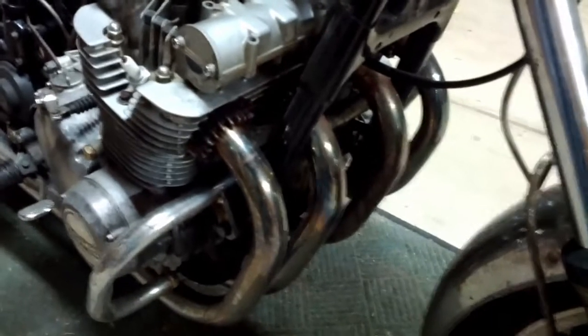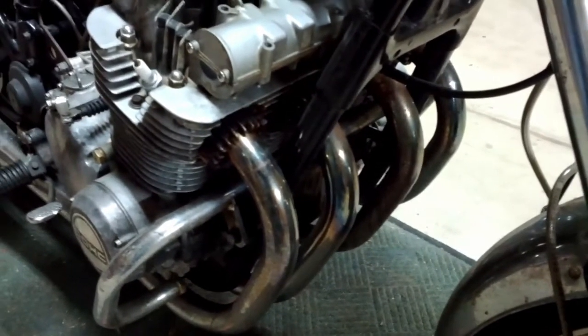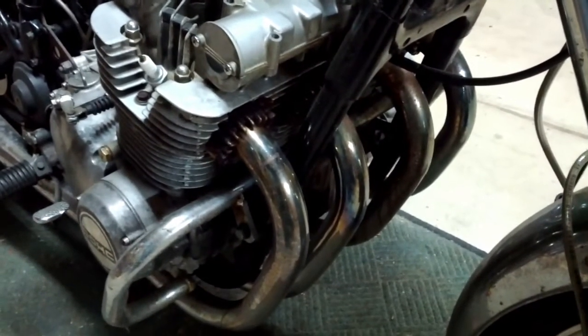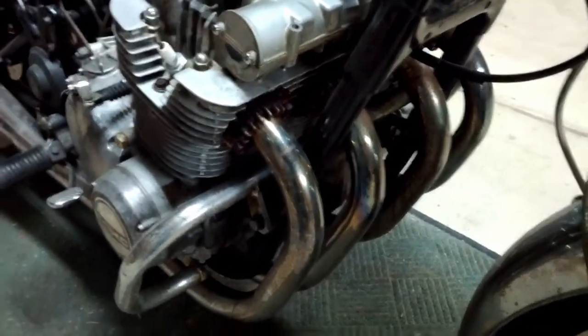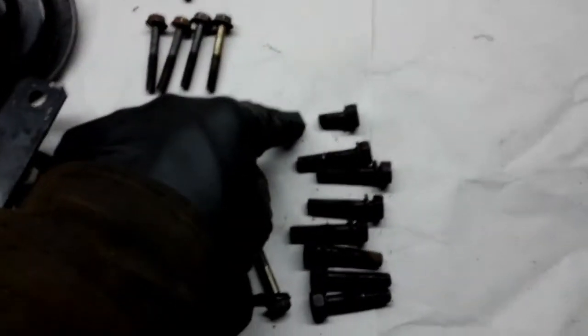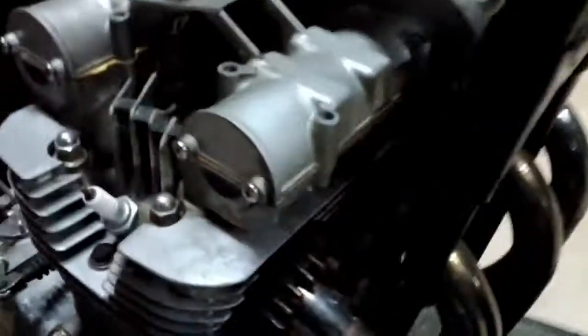So I'm going to have to go at it with tapping them, heating them up, trying to work them loose. Hopefully it's not going to take that long, and hopefully I don't break a bolt. And the exciting results. I'm knocking over my PB Blaster. The exciting results are 1, 2, 3, 4, 5, 6, 7 came out whole. 8 did not. The bastard. So I wasn't able to get the one really stuck one out. So it broke. Yeah, well, probably not the end of the world.